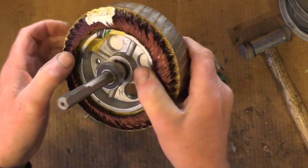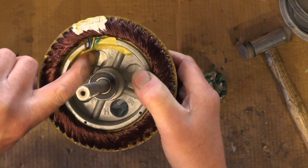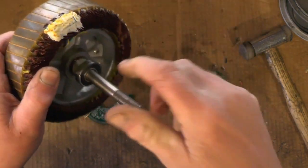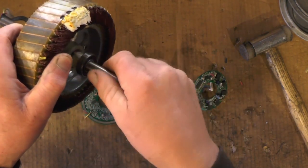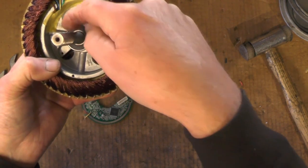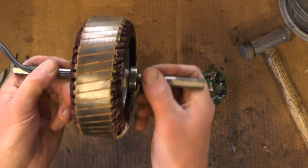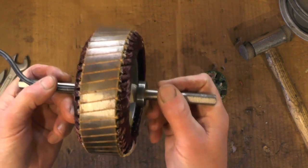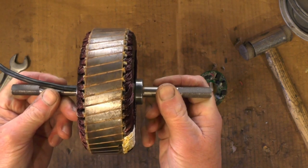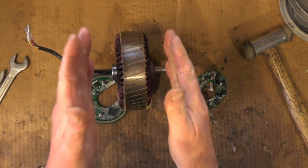While I'm doing that, I'm going to solder some wires onto the hall sensors and extend those wires. While I'm machining the thread on and cutting the shaft down, I'm going to put another slot in this side to bring the hall sensor wires through. So I will eventually have two wires coming out of each side. That's my plan anyway. I'm going to the lathe now to see if I can get some threads put on to extend these threads down to sit in my dropout on my wheel - 100 millimeter.